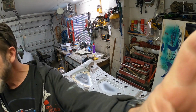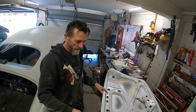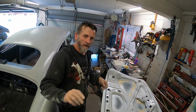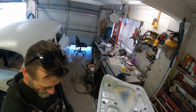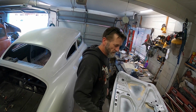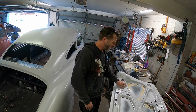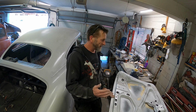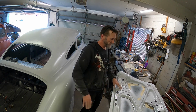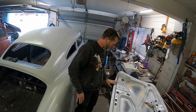Yeah, joy. Alrighty, so that was an ordeal. Right, I've got the NewTek fiberglass, we'll call it, all down to where it's ready for the first skim of normal Bondo, so bog, filler, whatever you want to call it. It was a bit harder to sand down than I was anticipating, and I did get the DA out to hit the flatter areas, and it went into grinder mode, so it went sparks, all that kind of stuff.